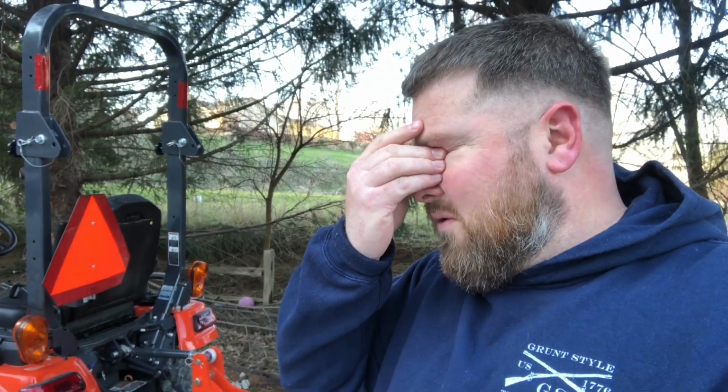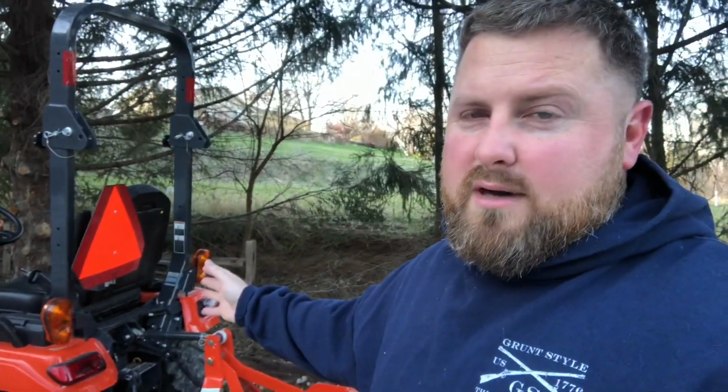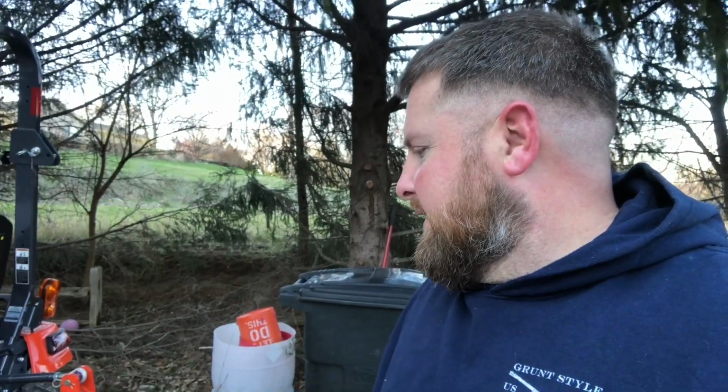I mean, I just don't know what kind of damage I've got in that front end, and there's no way that they're gonna warranty that down the line when it does start giving me issues. It's probably gonna start giving me issues after my warranty's up, obviously, and then I'm just SOL. I'm gonna try to talk to the dealership and have them drain the oil out, and if they see a lot of metal flake in there, hopefully they will pull the axles out, check the angle drives in that axle, and warranty those parts and replace everything up front, because that's the worst thing I can think of to do to the front axle: run it with no fluid.